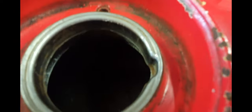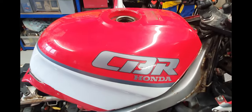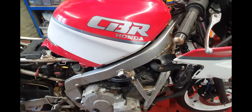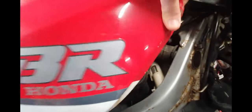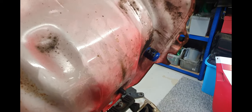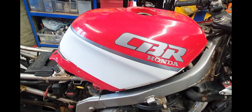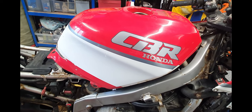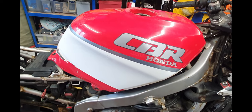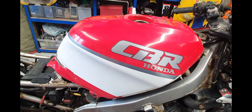I've tried to get some photos inside the tank for you to see — it's quite rusty, it's been sat for about five years or so. The process is going to be: the tank is empty, we've blanked off the fuel feed with a little rubber bung, then we'll wash it out with some diluted warm washing up liquid and fill it to the brim with white vinegar.